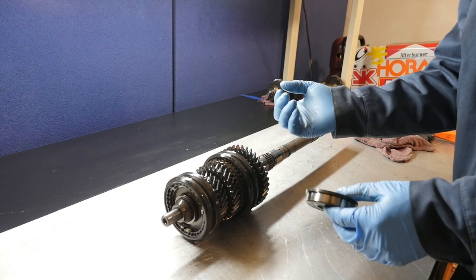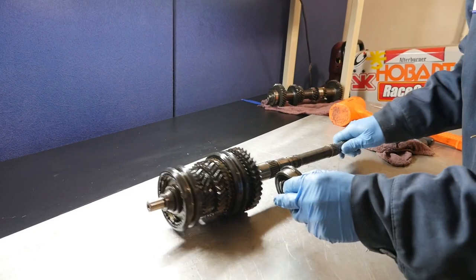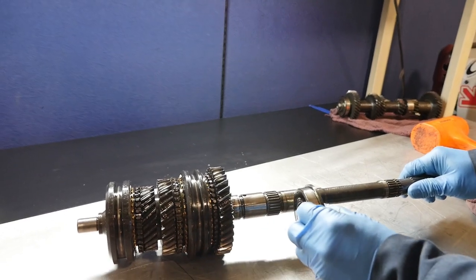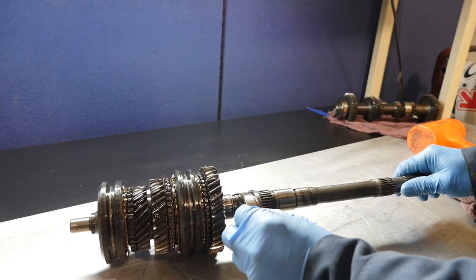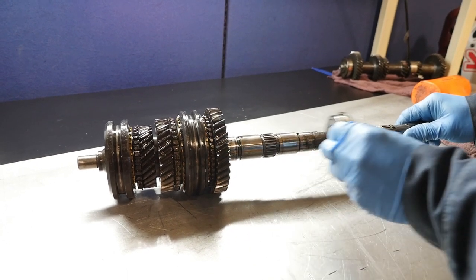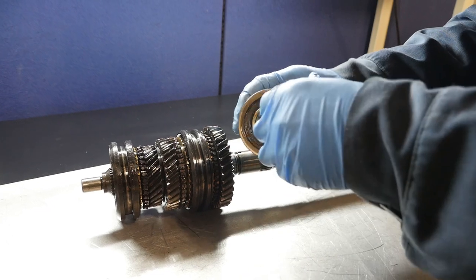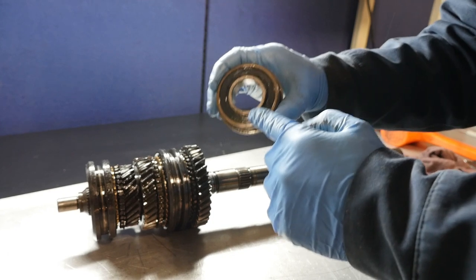At the end of pressing I hit the shaft down a little bit — the shaft still has to get past this section, which is a relatively tight clearance fit, so I tapped it a couple times to get it all the way off. This is the GTS one because it's double-shielded — it has a rubber/plastic seal on both sides. Always get this bearing.